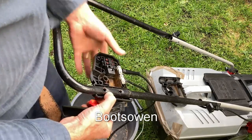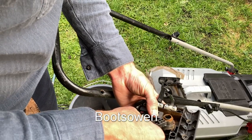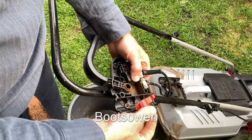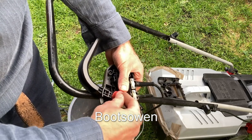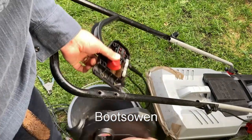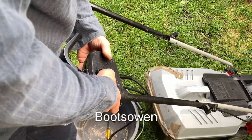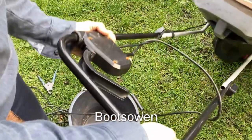Just figure out how to get this back together now. Put that like that — and it would have been like that. This handle went in here first of all, and there's a spring there. So that must engage somewhere like this — see that little spring tab there in the back, slots in here in this case, but it could be anywhere really on these things. This goes like that, so take that off, put the spring on the center, push that on there, and it stops it turning until that's properly down. Then hold this — it's so complicated. Hold that like that, try and snap it all together at the same time. Push that in first, bring it in from the rear — that might be it. Flip it over and get these screws back in.